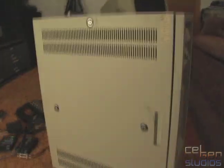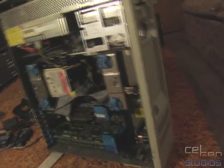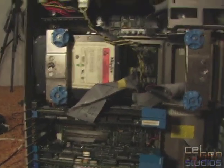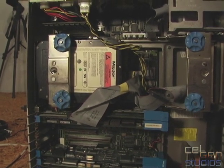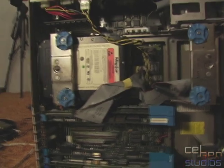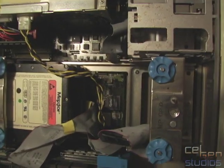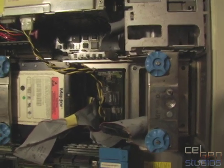We'll open it up and put that off to the side. Inside, what we have going on is that to make AIX work on this system, two major things are required. First, you can just barely see it in the back there — there is a Cyrix math coprocessor. Second, a decent sized hard drive. I have, I believe, a 700 megabyte five-and-a-quarter inch full height SCSI hard drive here.